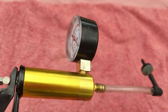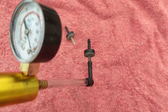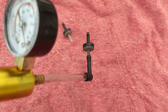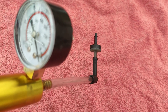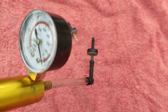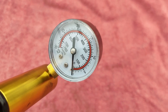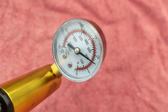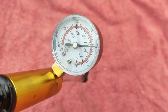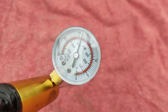So for the price of one of these little gauges, well worth having. I thought that might be useful to somebody. If you think you've got an N75 valve fault or a turbo actuator fault, obviously do your vacuum test and check the local pipework first. But then don't discount the fact that you might have more than one problem — I certainly had a combination of two issues. This is dropping so much now. I'm surprised every time I put the brakes on I didn't end up with a fault or a problem with the turbo. Maybe it's now just got to the point where it was so bad it was actually causing an error code. A leaky six or seven pound valve.